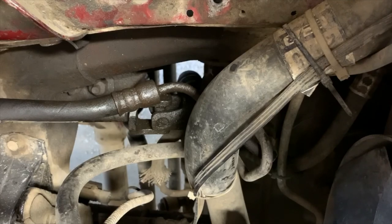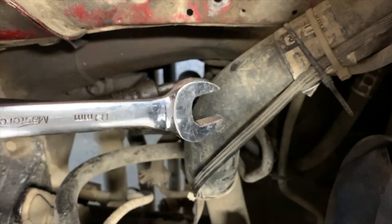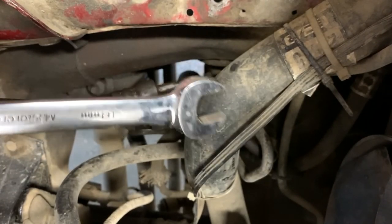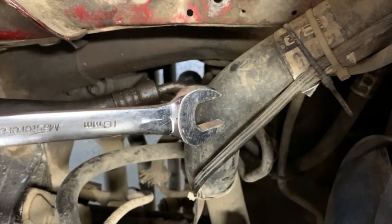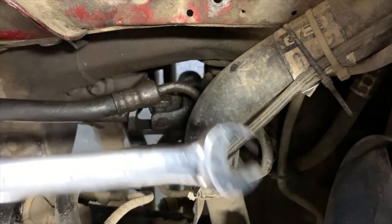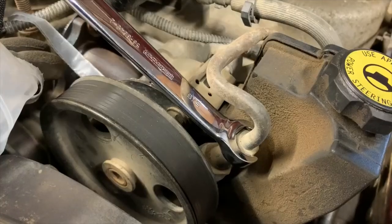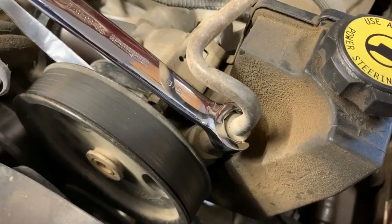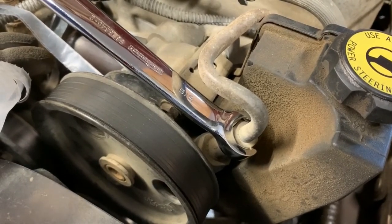Keep in mind you'll be using a wrench — mine's 18 millimeter. This is a Cherokee, so if you've done any wrenching on it you'll know sometimes it's metric and sometimes it's standard. Try not to tear your hair out; just carry both and try both. Also realize that just because you're putting on a new part doesn't mean it won't be a different size again. A flare nut wrench — turns out a 5/8" fit really nicely up top, go figure.